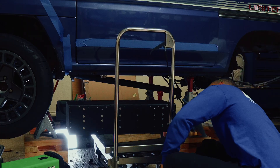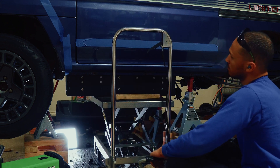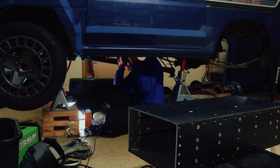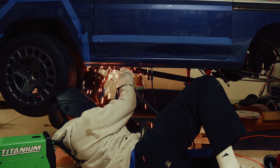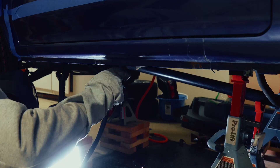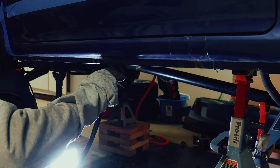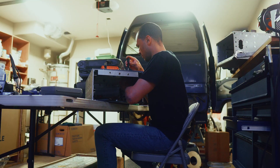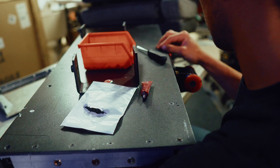After I had the boxes basically put together and painted, I had to figure out how to mount them to the frame of the van. I drilled out two holes on each of the frame rails under the van and welded in steel tubing where I could add rubber bushings to have big U-shaped mounts that would hold up each of the boxes. I won't show you the welds I did — number one, because the camera angle was really tough, and number two, because I don't want to show you the welds I did. But rest assured, they're sturdy.